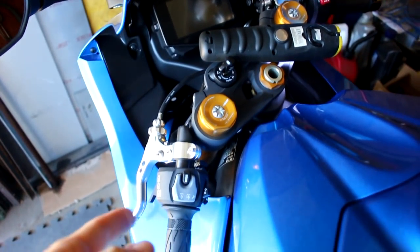Can you see that? Just above the back of the flashlight, just to the right of the fork and above the flashlight — that's the hose going into the cooling bottle. I've got the spray bottle sitting right there on the ground, and now I'm just going to pump it up to fill. Keep going to the other side of the bike to check the fluid and make sure you don't get above the full line. You can already see how the fluid's making its way up there. Watch as I pump the handle — see it coming up? Just keep squeezing the handle and it'll keep pushing it up into the tank.